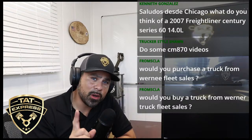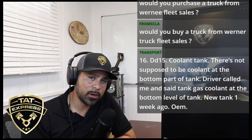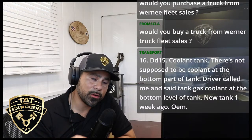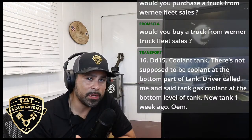One thing is very important for the guys down here in the South, so you've got to listen to this. If you've got a DD15 and you haven't serviced your coolant system in over 300,000 miles, I would suggest getting these coolant strips. If you come visit our location, we have coolant strips. We do this during our services. Checking your coolant level and your nitrate levels is going to be very important, especially if you own a DD15.